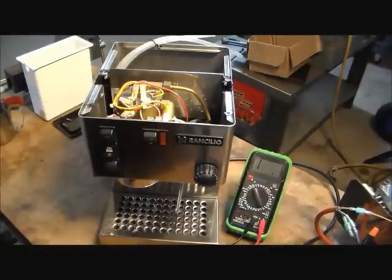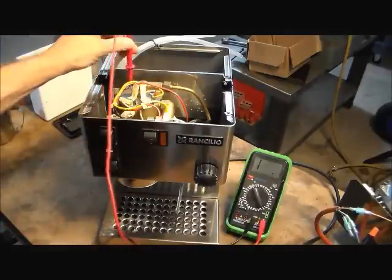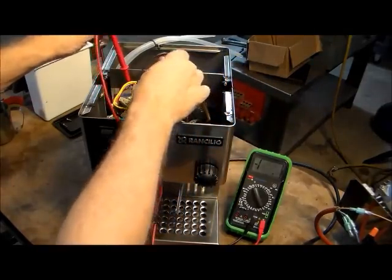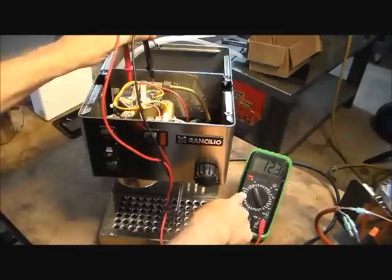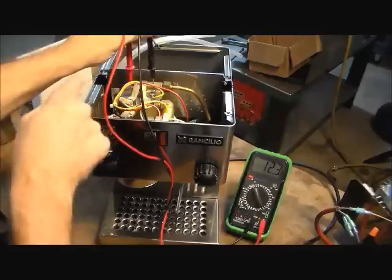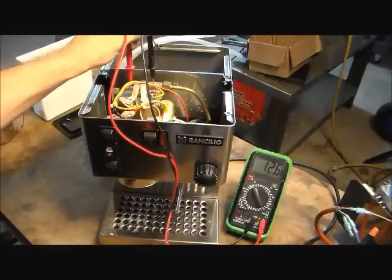With a little bit of electrical testing, we were able to figure out that, yes, we were right, and that the heating element is exposed. If you take and you probe the heating element, and then you push it to ground, if you look at the gauge over there, you should not have any ohms continuity reached between ground and your heating element. The fact that you do means that our heating element is popped.